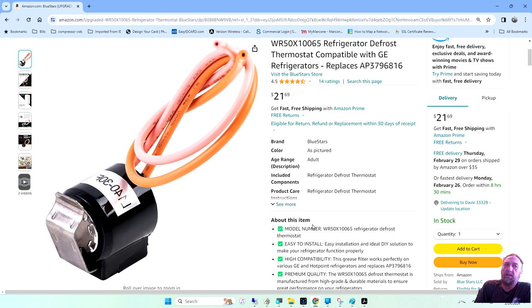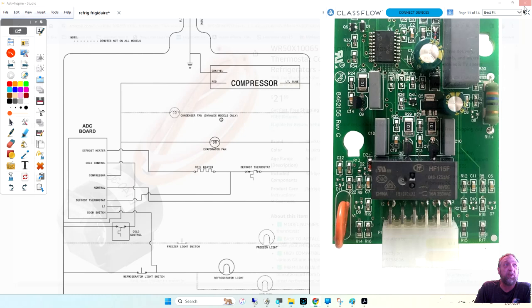That's extremely high. But like I said, that 140 degree thermostat is what a dryer uses, 140 to 160 on high heat. That's why I'm saying I've never seen that. I will get back to you on that. That's way above and beyond what I've seen. But so when you said a universal thermostat, what's the rating on that one?